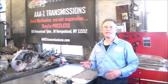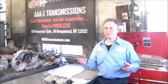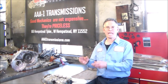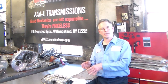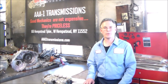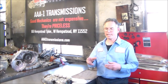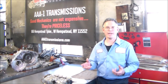Now I'm probably going to make one video out of some footage that I have, because I have footage of me vacuum testing the actuator feed limit valve. You can see the vacuum was low. We put the oversized valve in and then vacuum tested again, and it was what it should be. I'll probably edit it somehow where I'm doing the actuator feed limit valve maybe from the other transmission, because that's where we're using the vacuum test.